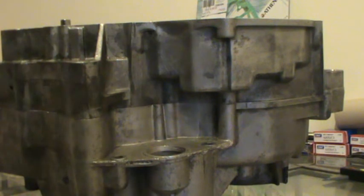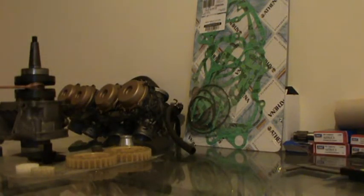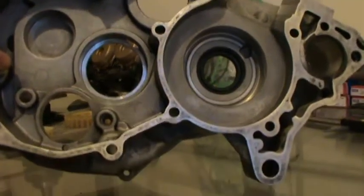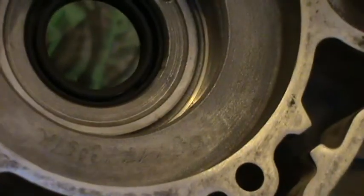I've spoken to a garage about this - the same thing as what I did with the crank. He said the crank would be better off being repaired regardless, and it would mainly be the conrod bearing that would need to be changed. I said I'd already changed all the other bearings. He said no, the bearings on the conrod would be better off changed. But with regards to the crankcase, he said truth be known, you can get it shaved off ever so slightly, though it would cause a detrimental impact on the overall dimensions. It does make a difference. With the crankcase, you can see that it was bedding and gripping on quite nicely - the gasket set has left an imprint.